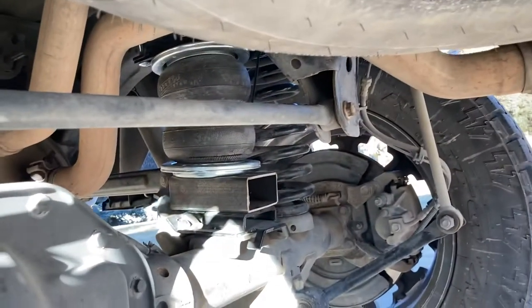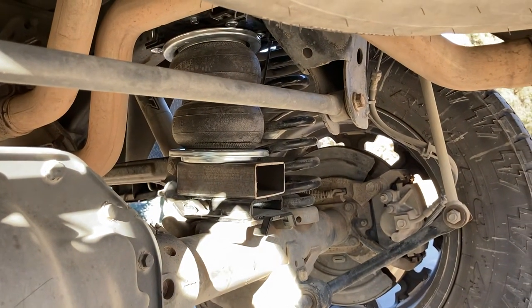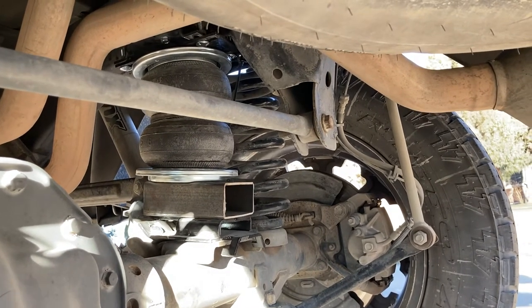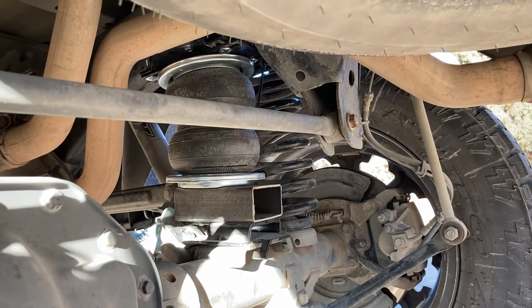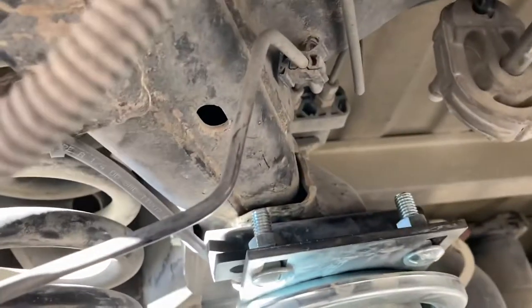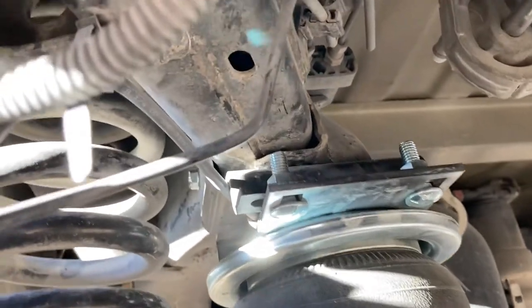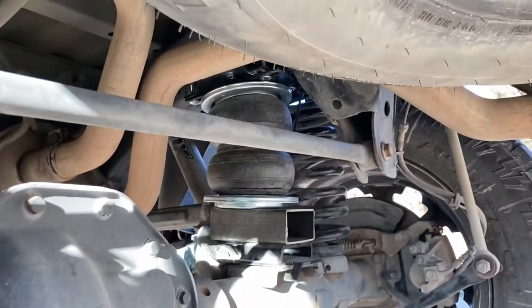You can see the other side over there. The bracket for the lift — that quarter inch probably is what that is — shoves it back a little bit. But you do have some adjustment up here on the top. These are now sitting towards the back, which is fine — it's all slotted. So you do have some adjustments and you can still get the bags pretty much exactly where they need to be.